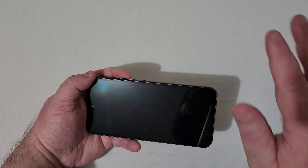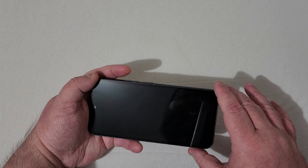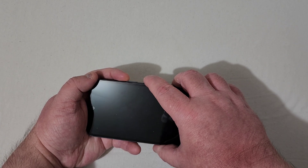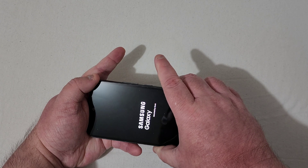Just a reminder — do this at your own risk, it will wipe your phone completely clean. With your finger hovering over the volume up and the power button, we'll press them together at three, two, one. Now vibration — let off.